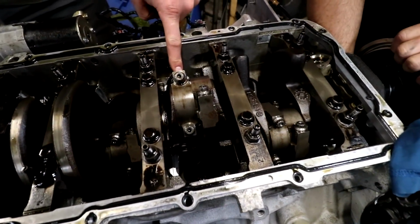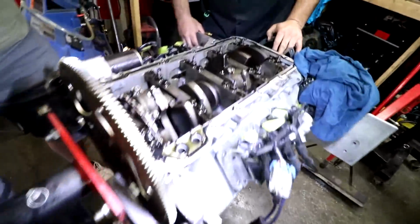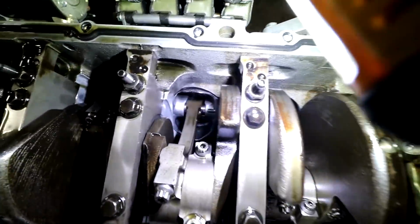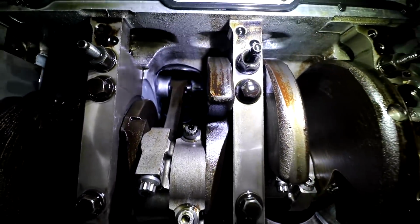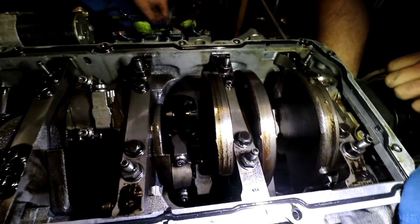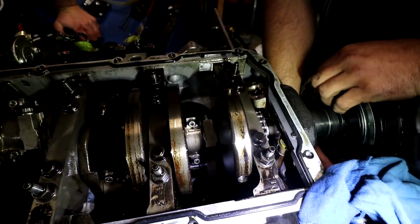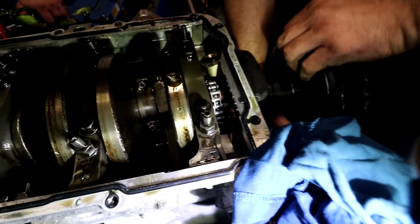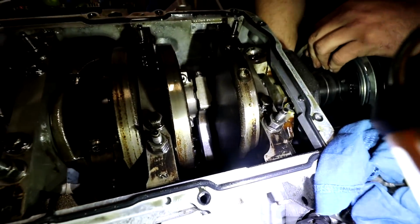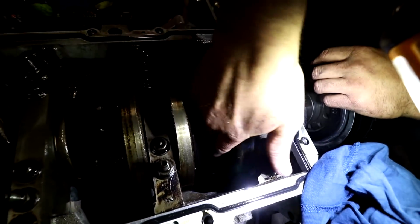I highly doubt that one, right Kyle? This one here is done. Is it? Yeah. Oh yeah, that one's bent too. Where's our light? I have the oddest feeling our center one's got far more spicy. Yeah, that one's bent, number 4. I marked them, see? Number 4. Hard to tell on that one. What about your front? I think these two are pretty straight. Those are the ones that the most coolant was in too, so they might have hydrolock bent them. That one looks bendy a little bit on the bottom-ish. Well, sorry, that one was bent too. It was bent like right here.